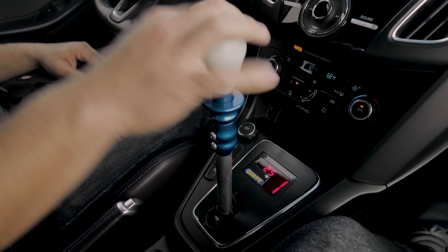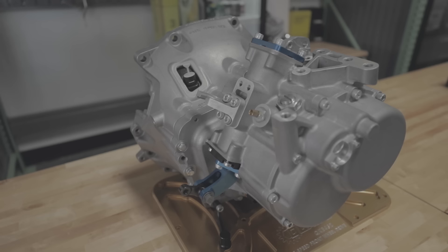There's a little bit of a clunk. What that means is the input shaft of the transmission has now been brought down to the speed of the output shaft, which is zero because we're not moving. That is a major difference. If you were in your factory transmission and you put it in first gear, you wouldn't hear any audible clunk — it would be very smooth. But yeah, this is kind of a racing feature made for racing.